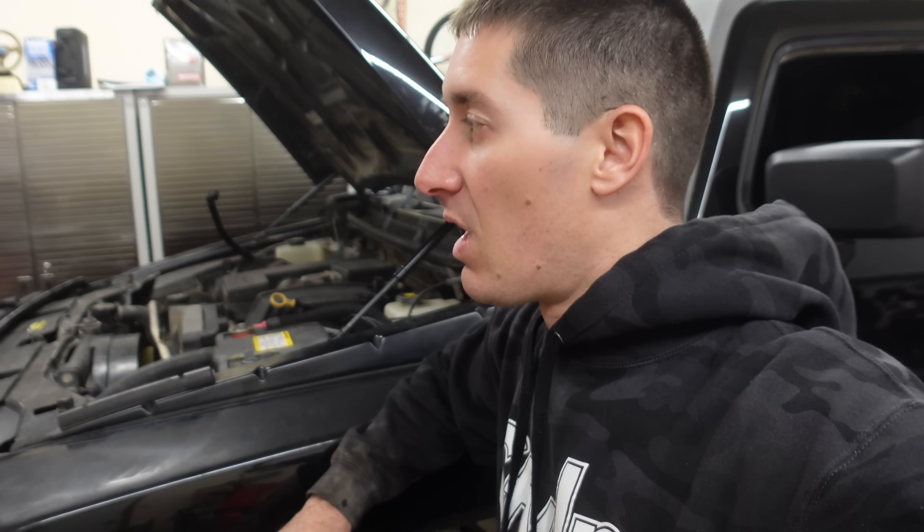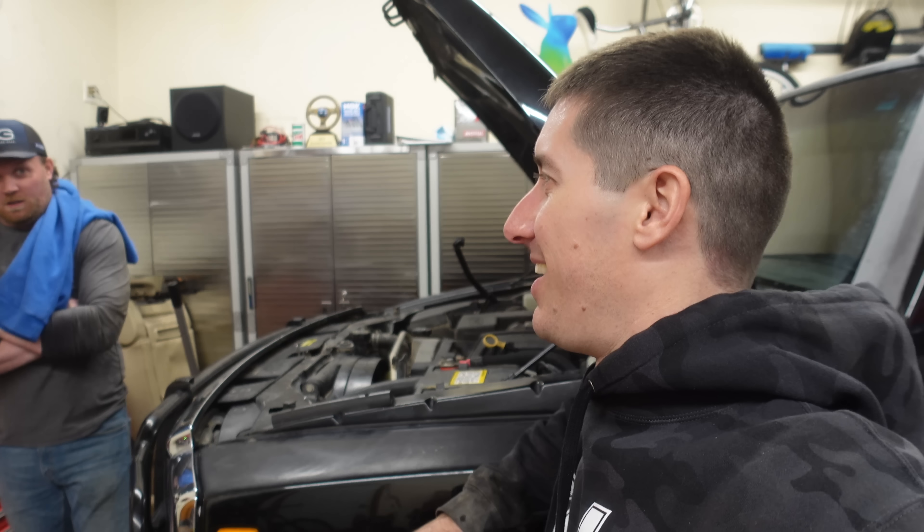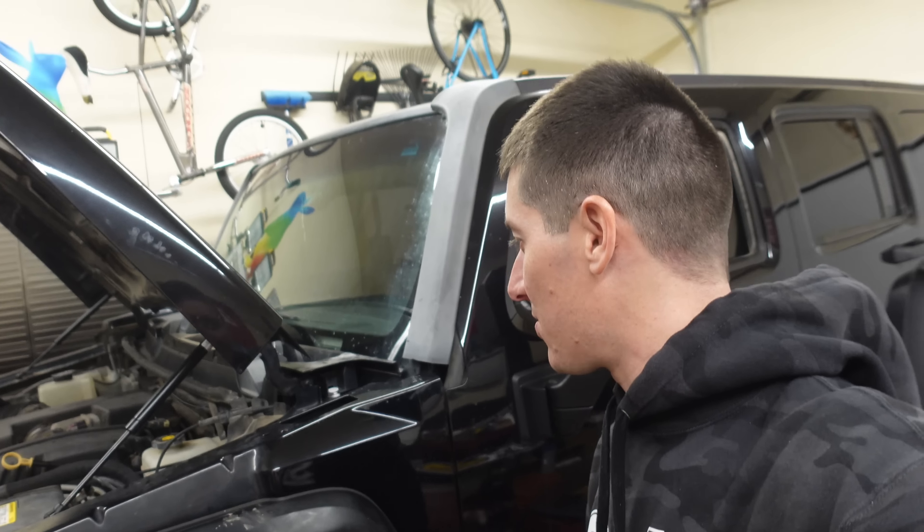Honestly looking at the mess we have here, it was definitely done wrong — they went to the cheapest transmission shop. Two bell housing bolts were missing, most of the rest were pretty loose, and a bunch of the tabs for stuff weren't in place. It was a bit of a mess; I don't know that they followed torque specs. So we have to put it back in right. She'll be off to her new owner once we get this thing all done and back on the road.